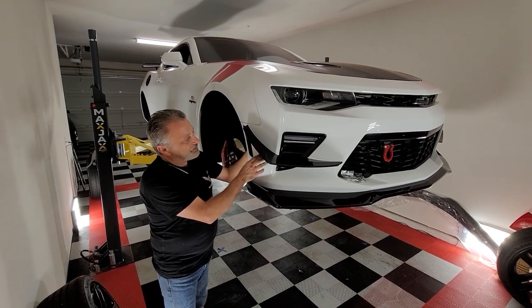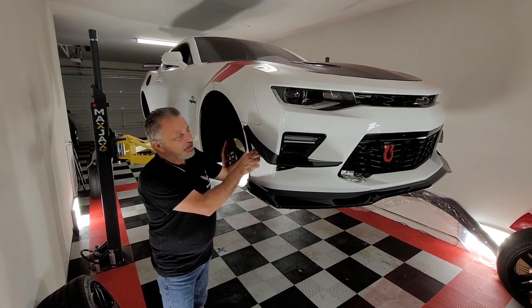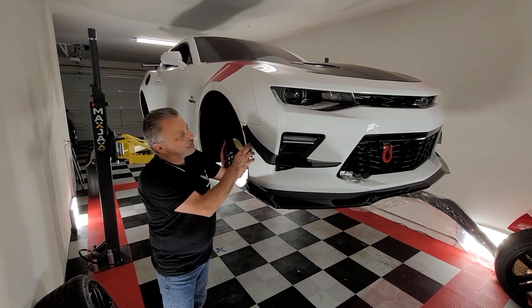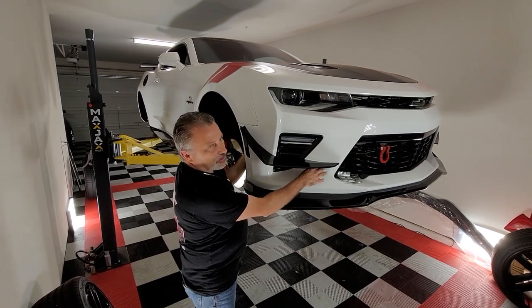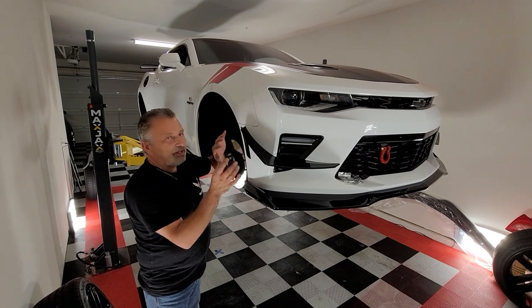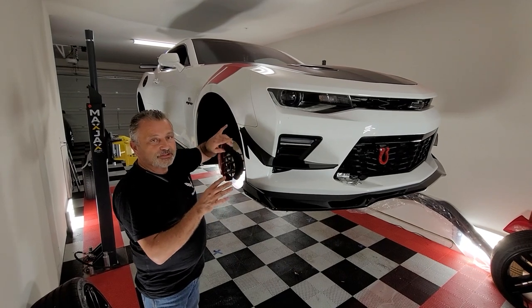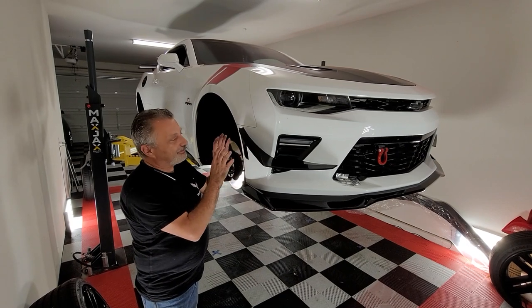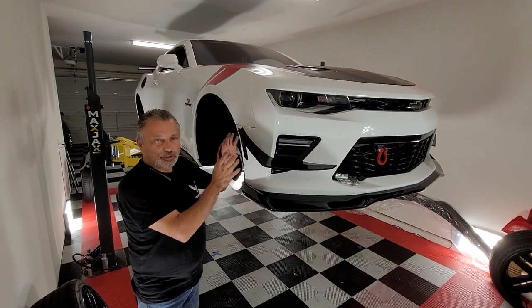What we determined here is that we can get to the two screws up at the top and the two down at the bottom, but this one here is going to be going through the air box and it's going to be almost impossible to get anything through there. So we're only going to do the top two and the two bottoms, but we are going to use all the rivets down here at the bottom. On the other side, the two center ones we can't use, but we can use the outer three — we'll be overkill but we're just going to make it look balanced.